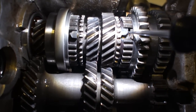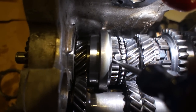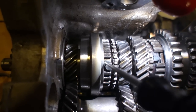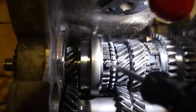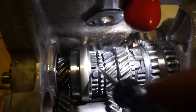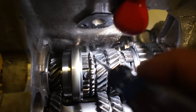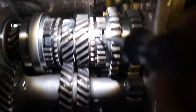They're supposed to be a gap here. You push this one forward and you can see there's a small gap here. There's no spring or anything — this just sits engaged on the shaft and is always turning. When you put pressure on it, it puts load on the gear to bring the two into the same speed — it synchronizes their speed so that the collar can slide right over these little teeth.